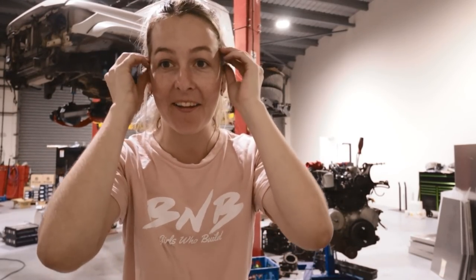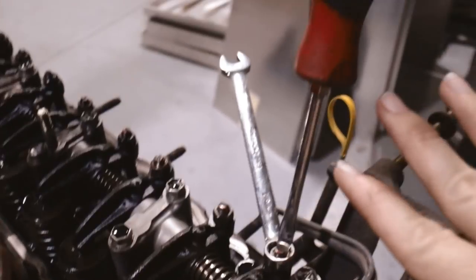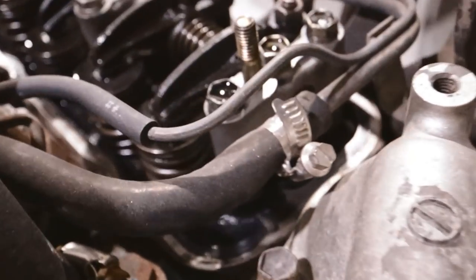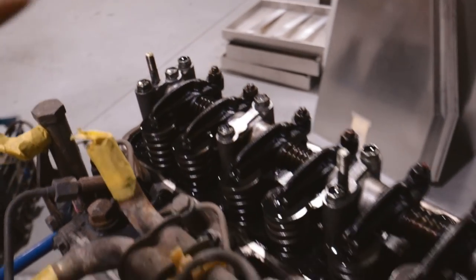It is significantly later — it's like 7 o'clock at night. So the 12HT is here. Because the engine's out, you can see a lot more, so you'll be able to see the timing marks and I'll be able to show you the rocking action. This here is the timing mark, and then that little white line is on the pulley for the crank — so you line those up. This is pretty much what you need: screwdriver, spanner — this is a 12mm — and feeler gauges. With that timing mark lined up, you can come up here and check that number one is loose and number six is tight. That means cylinder six is rocking.